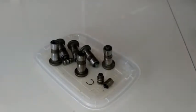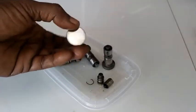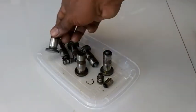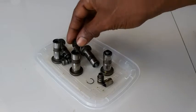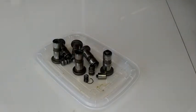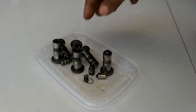If you purchase aftermarket lifters, it does not guarantee you that the alloy, the steel, the metal, is of the same grade and quality. Sometimes it's going to want to wear out on the bottom and on the sides. So in the event you have to purchase new lifters and you can't get them from the Nissan dealer, it's always best to clean these original lifters. Use the spring out of the aftermarket lifter, but reuse the original body and plunger because this is better steel. We do not know if aftermarket parts have the same Rockwell hardness rating.